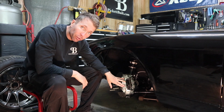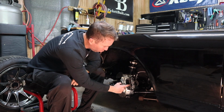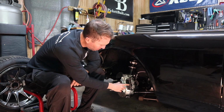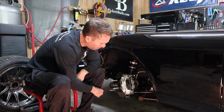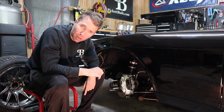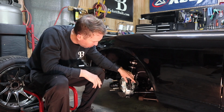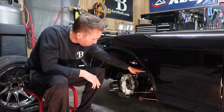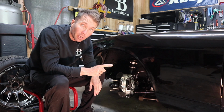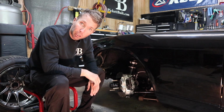Alright, the new calipers are on. One thing to note is there's only one of these little spring retainers here. Seems like there would be two, but I'm only seeing one. Pretty sure that's how that goes on. Leave a comment if anybody's had experience with that, but everything looks good to go. New brake lines are on. All we need to do is get the brake line on the rear, get some brake fluid, and bleed the system, and we should be good to go.